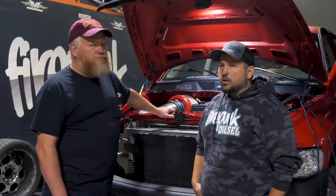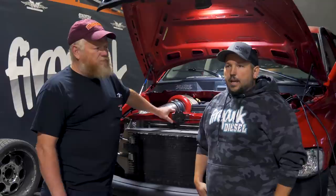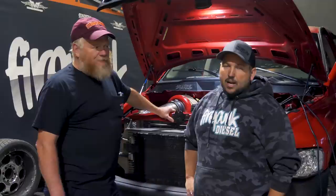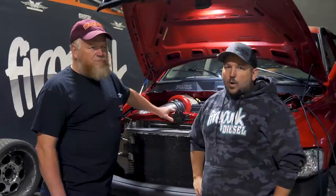We've had a 485 make 1385 horsepower, but this is an 82, and we're going to see what power it can make. Something that was unique about this truck this morning: we read the stock file out of it, and it's a 04.5 truck, but the tune file coming out of it is for an early 04, even though it's got an 848 ECM. So we're fighting a little bit of map sensor scaling and some rail pressure correction additors that are a little bit different than normal, but we're going to try to get this thing dialed in, make a couple whacks on it, and try to get Tim back on the racetrack.